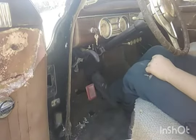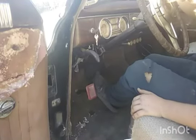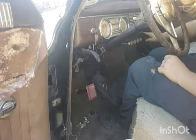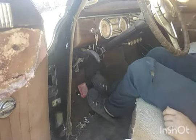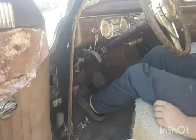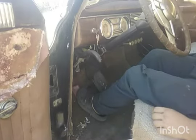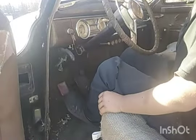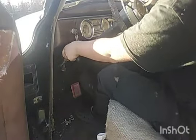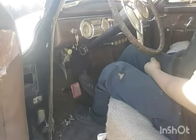This is a Packard with the optional Electromatic clutch, and I'm going to demonstrate that. We'll start the car back up. As we can see, the clutch pops up and down. Let's hit this button on the dash called Trans — with that button hit, you heard the engine speed change and you can see the pedal is stuck to the floor. If we give it some gas, the pedal will automatically start to come back up, but there's no feel. The vacuum is no longer holding the clutch down, so you give it gas and it's basically like an automatic transmission. That's awful for hill starts — you have no brake to hold you, just your clutch and your gas, except the handbrake. But it's actually a really cool feature — great for stop-and-go traffic, not great for hill starts.